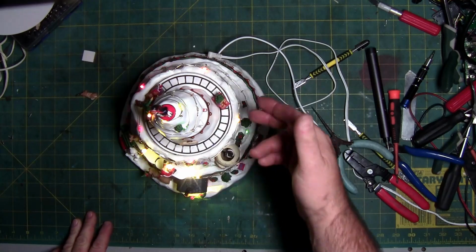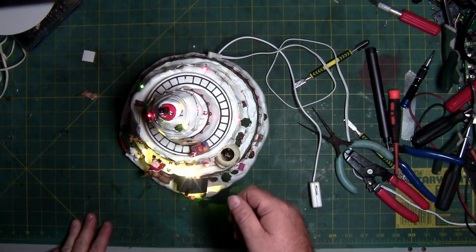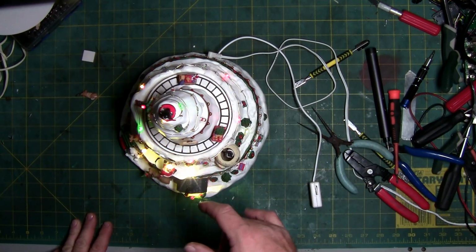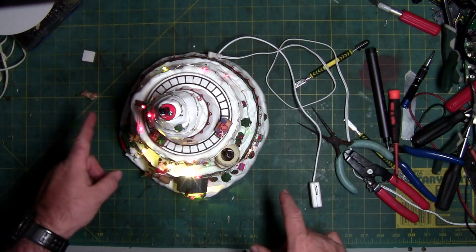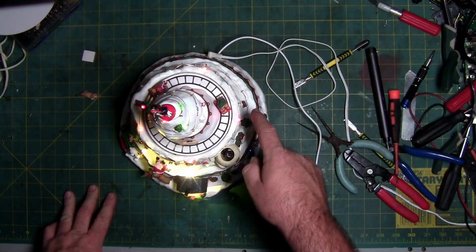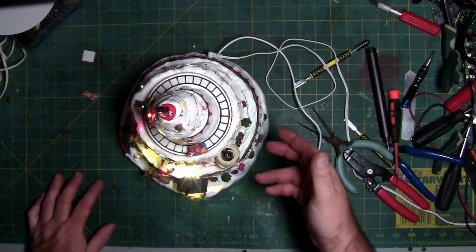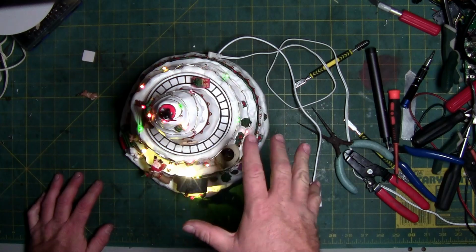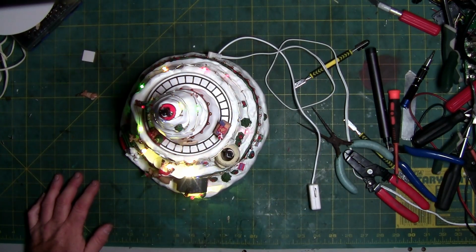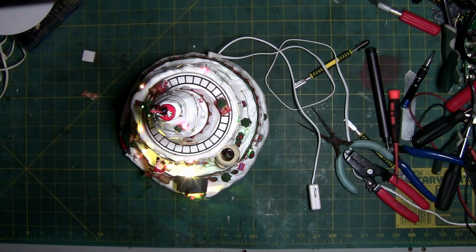Now, the wires aren't long enough, as you saw, so if you have to move this over, mark the wires. You saw I use red, green, blue, and black. And that left me with two white ones, a white one on this board and a white one on this board, which is the power, or excuse me, the motor. The power I painted red, so I know it's power, red hot. The five-prong wire, which comes from the switch, I don't paint because it's the only five-prong wire ever on these circuit boards, so you don't have to do anything with it.